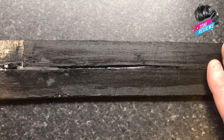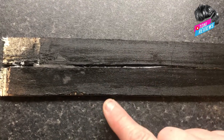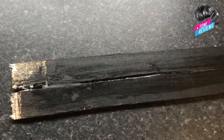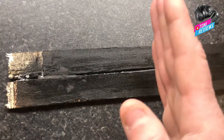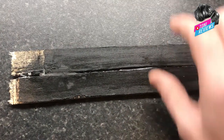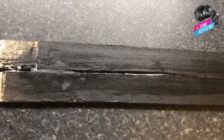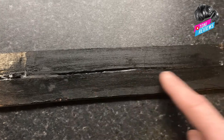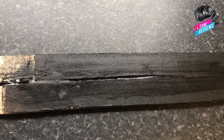So I've got a couple of options. I either pull the entire roof down and don't bother with the cross panels — instead running two panels the length of the van and one panel across the back. If I join two lengthwise panels with a gap down the middle, I could hide that gap with a tongue and groove slat sitting behind it. There'd obviously be a section at the back that would have a gap which I'd have to Sikaflex, and you'd potentially see parts of that.